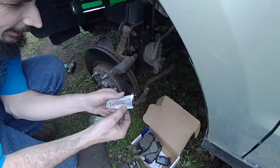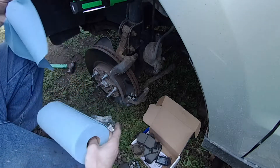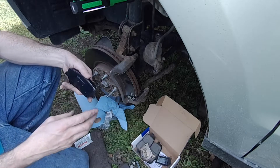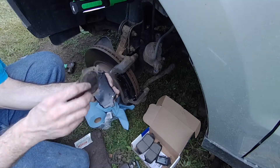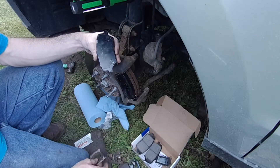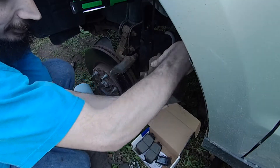Now you just want to put a little grease in those sliders. I have this Bosch grease I like, so I'm going to use it. That's just to make sure the new pads slide nicely in there. You don't want to get any grease on your new brake pads, so clean off your hands afterwards. The squealer goes to the back side, and the one without a squealer of course goes on the front side. You also want to put some grease where that piston rides on the pad — there's a friction surface there. Put a little grease on the front side of the pad as well, because that's where the caliper rides.